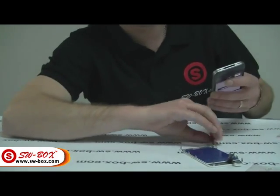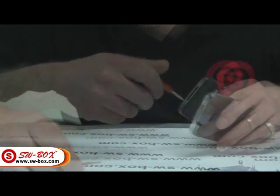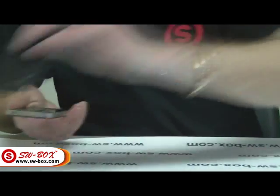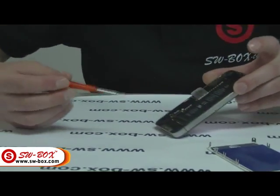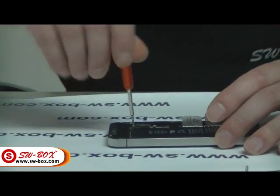Then you've got to remove the two screws at the bottom of the iPhone 4. Take them out and put them with the items you've taken off — you can use the screws again. Now we're going to remove the battery itself. There's a little cover that holds the battery plug in place, so we take that off.